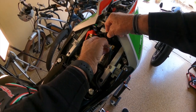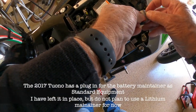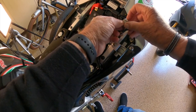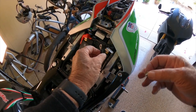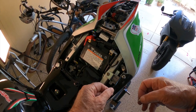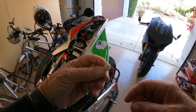So, remove the negative side first — getting my fingers in there. Luckily I have small-ish fingers. Ladies and gentlemen, that's tight. Okay, it's loose now. It wants to come out so I'm going to try and grab it. There's the cable that goes into the other bits of the motorcycle. And here's something coming over from the negative side. I also have a power takeoff on the other side. The negative side terminal is released — let's go on to the positive side.